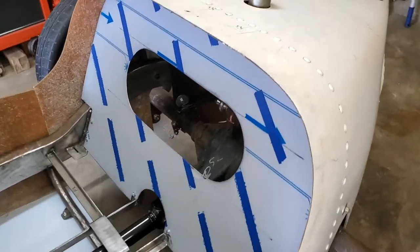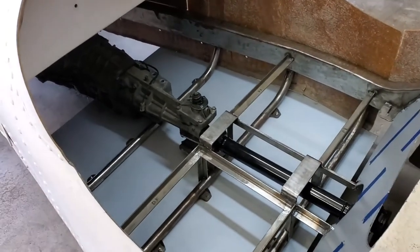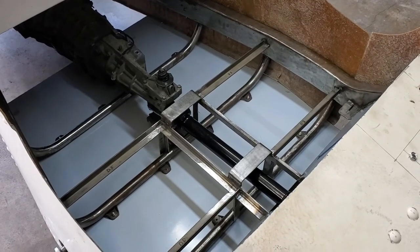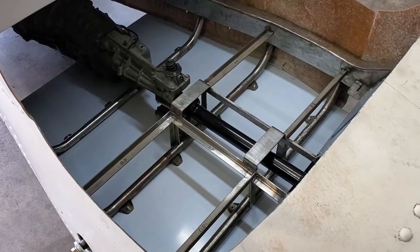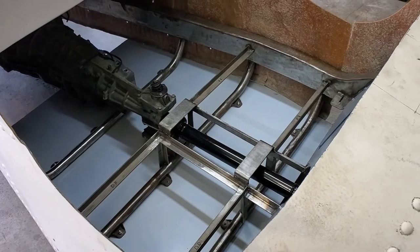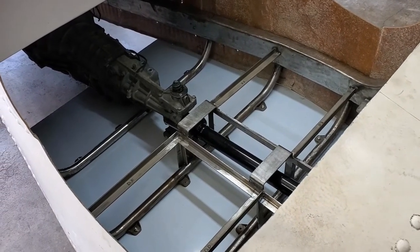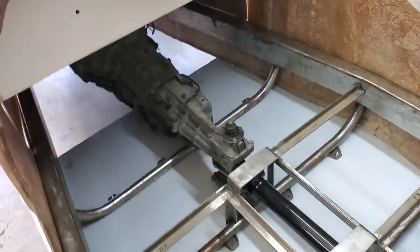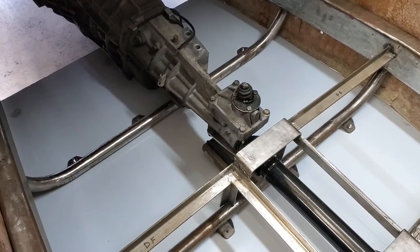After the bulkhead came the floor pan, also made out of aluminum, but this time from eighth-inch thick sheet, which sounds big and heavy — especially if you've got steel on the brain — but it doesn't really weigh anything. The reason for the floor pan being thicker than the bulkhead is the weight it needs to support. When you get in and out of the car on both the driver's and passenger's side, you'll actually be standing on the floor pan itself, right between the first and second cross members, so I wanted to make sure it was strong enough.